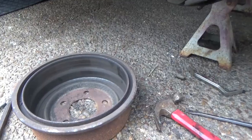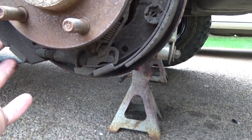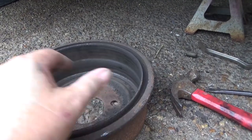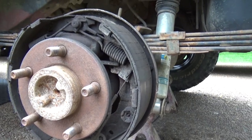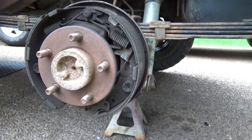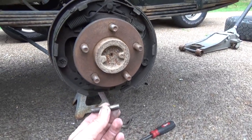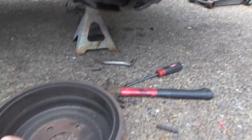Let's see what Will's doing. Alright, so we got everything off. You can see where the adjuster is here. As your brakes get so far worn that it's into the metal, this will keep going and then it'll get stuck on the drum. You can see where it's grooved on this drum — the rivets basically just stick it on there where you can't get the drum off. We'll take this up to O'Reilly's and have them see if they can turn it. They may say it's too far gone and you'd have to buy new ones. What happened with Will's brakes isn't that the actual brake shoes were worn out and went metal to metal — what happened was a spring broke, got down into the drum, and you can see where it rolled around in here. It made all kinds of noise and scarred up the drum.